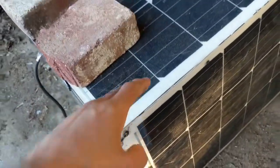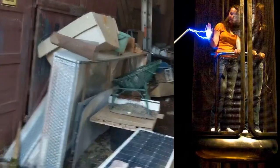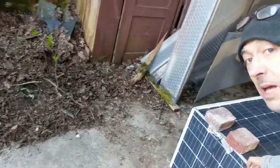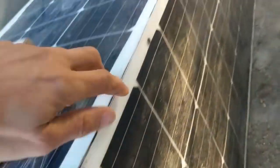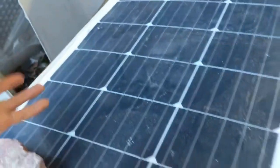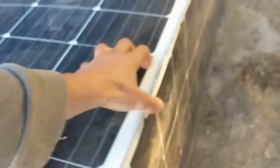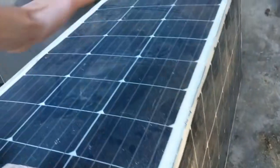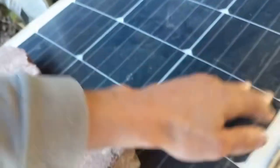I will show you the inside afterwards. Just for now, this is not a Faraday cage, I think. There is 1 millimeter of aluminium in these broken solar panels, and there's a wood with aluminium foil wrapped inside. And yeah, technically here the screws do connect the sides, but a Faraday cage would be a complete electrical enclosure, all at the same potential, to cancel the incoming waves from the front and the back side. Therefore, they need to be electrically connected.